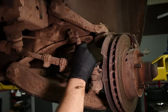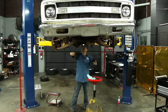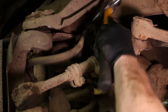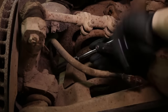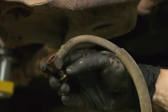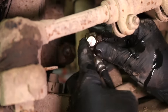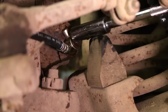And the ever alarming nearly dry brake circuit. Now we can get rid of these old lines. Now we're just going to go ahead and replace our flex lines with the copper washer on either side of the banjo bolt. You know it's in the right way when the nib on the top falls into the channel on the caliper. And that's going to weep from the caliper for a little bit.